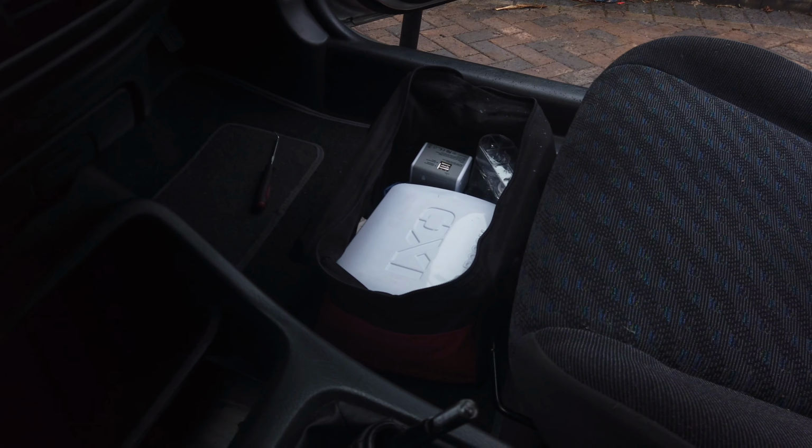That's the gearbox oil. Oil filter drained, and when it drains, it sits on top of the engine there. And it's tight enough, so it shouldn't be. And it's dry under the oil filter. So why is it all this around here? It's weird that it's above. Because obviously this is the gearbox oil. That's the gearbox and that's the oil in it. I made sure I wiped it all down before yesterday. We'll wipe it off again. When we've got everything sorted, we'll run it while it's up in the air and keep an eye on it, but I'll double check that sump plug as well. But the oil filter seems dry.